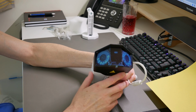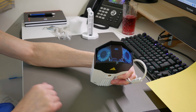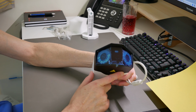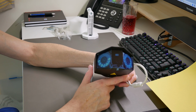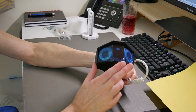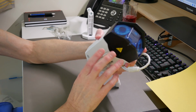For the smart detection on this, it has motion detection, person detection, vehicle detection, and also animal detection. And the recording mode is normally motion triggered, which is the default setting, and you can also have it as scheduled recording and also 24/7 recording. Obviously if you're using a micro SD card, then I would recommend you have it motion triggered rather than 24/7 recording. Otherwise you're not going to probably get many days of 24/7 recording on the SD card. It also supports time-lapse, and for smart home compatibility it will integrate into Home Assistant, and it also supports Google Assistant too. As I said, it's weatherproof, so it's IP67 rated.